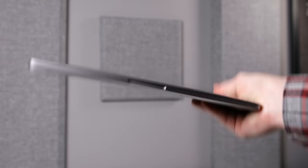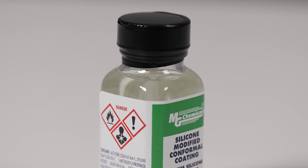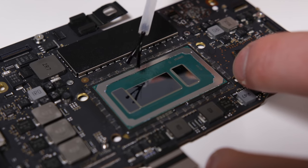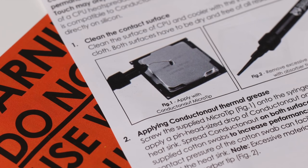As I mentioned previously, both the thermal performance and my perceived longevity of the hardware with liquid metal has been excellent. However, I've become a little nervous in recent weeks because the laptop is not a stationary one, so the liquid metal has more than certainly been jostled about. The conformal coating that I applied is supposed to create an invisible barrier between the very conductive metal and sensitive electronics. And I'm also nervous about the fact that liquid metal is highly corrosive to aluminum.